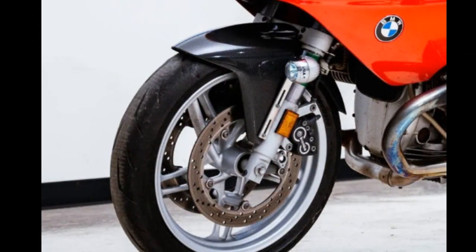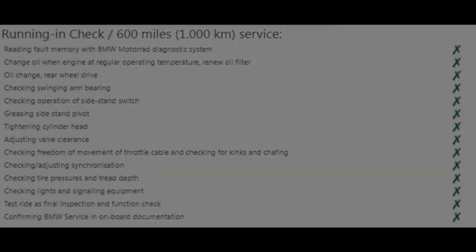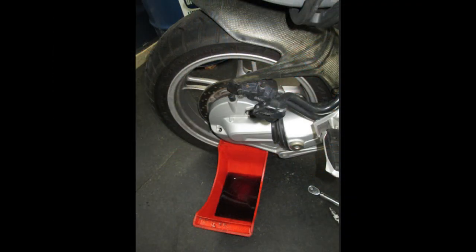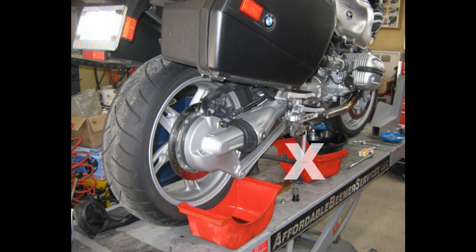A week or so later I have it back on my lift. The customer has put 600 miles on it and it's ready for its first service. The first service, like the rest of the oil heads, consists of draining your engine oil and changing your filter — done while the drivetrain is hot — then draining the rear drive and replenishing the 230 cc's of GL5 gear lube. The transmission does not need attention at this service since, as I said in an earlier episode, Getrag was flushing these transmissions with gear oil after assembly, so they no longer needed that first oil change at 600 miles.